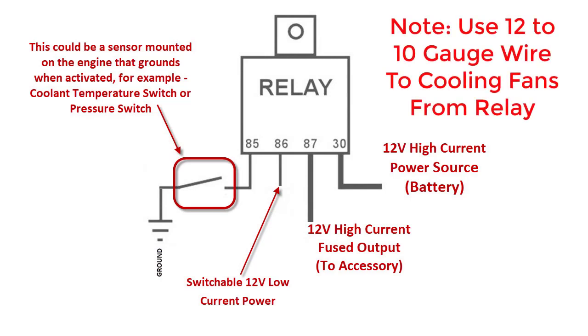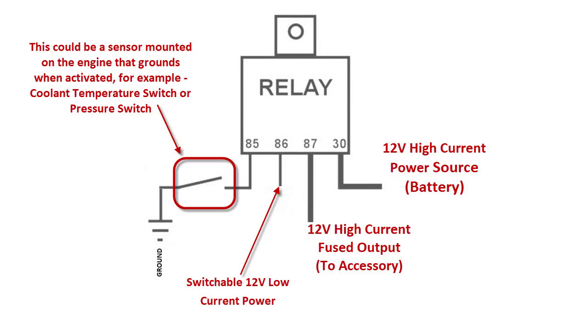You need to make sure your relay is a higher amperage than your fuse. You've got to figure out how many amps your fan draws. A lot of these fans, especially foreign ones from China, are measured in watts, so you're going to have to calculate watts to amps — I'll put the formula in the description. If you're running dual fans and they calculate about 7 amps per fan, that's 14 amps total. A 20-amp fuse would be plenty enough, since the startup surge is the highest draw. So if you use a 20-amp fuse between the relay and the fans, you want to make sure your relay is at least 30 amps, if not 40 amps, so it'll handle the load.